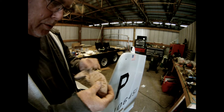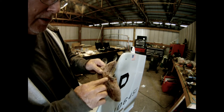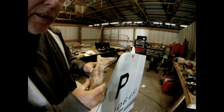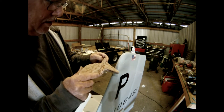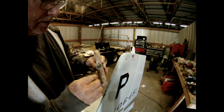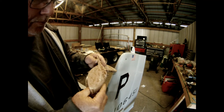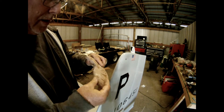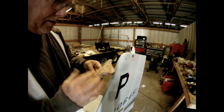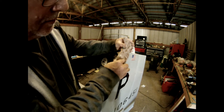Here's the almost finished product. I filled in underneath the mount where the screw is with some chopped strand fiberglass — like quarter-inch strands. Filled it all in under there and put in one layer of micro balloon which I've sanded down. I'm going to finish it off with a little bit of automotive body putty, but we'll see if this thing fits.